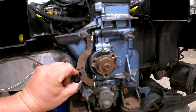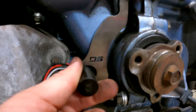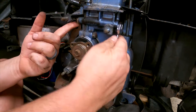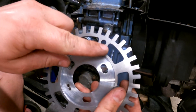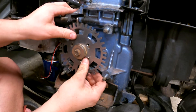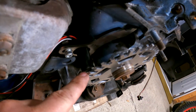Here's our trigger wheel — it is literally machined to say 'this side to engine.' We want number zero because we're doing a Haltech installation. That's going to bolt on there like that, and then the fan bolts will sandwich this in place. The gap we're looking to measure is right here.